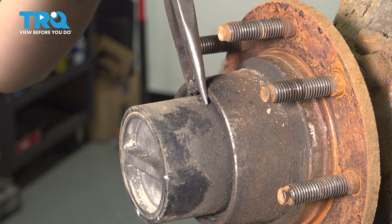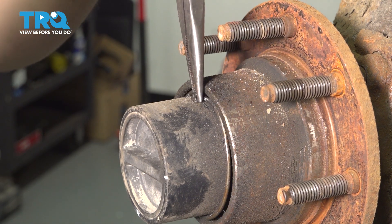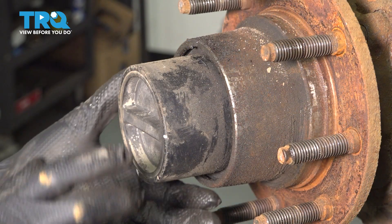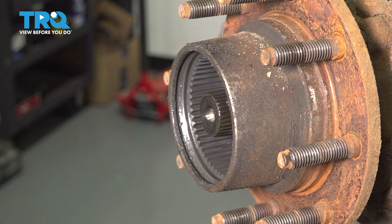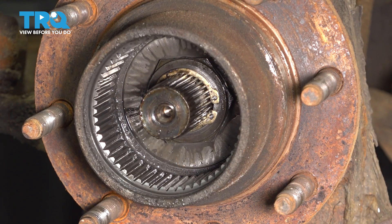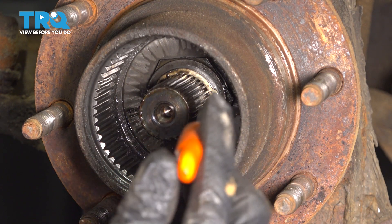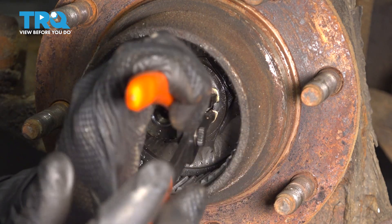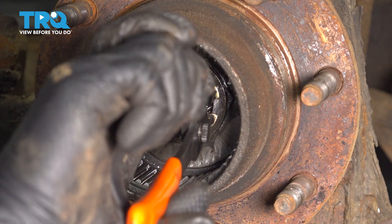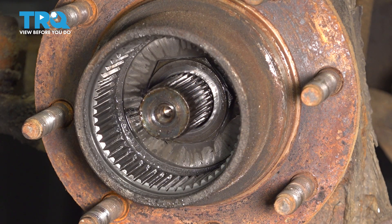To remove the locking hub, there's a large snap ring here that you can grab with some pliers and wiggle it out. With that set aside, you'll be able to pull this hub out. Carefully set this aside. Inside the hub, you'll see a snap ring for which you will need some snap ring pliers — get these in there, expand the snap ring and pull it out. Be careful so that you don't pinch your fingers and careful so it doesn't go flying. Save it — we will be reusing it, unless it's in poor condition, in which case you'll have to replace it.